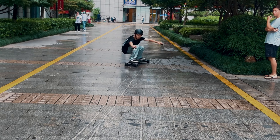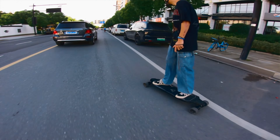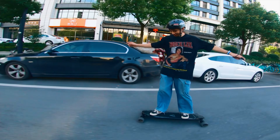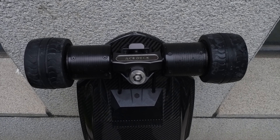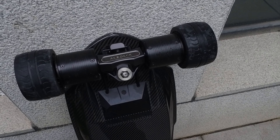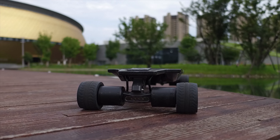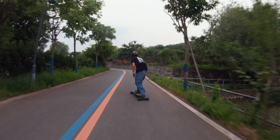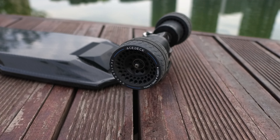Next up are the wheels. Stock, this board comes with 90mm polyurethane wheels. They feel alright, but you can do slides on them pretty easily, and on concrete sidewalks you are going to feel those bumps. We did manage to put on 97mm rubber wheels, and the vibrations from cracks felt a lot more mellowed out without really impacting performance. That's what I'd personally recommend, because with TKP trucks and a carbon fiber deck, you're going to feel everything on the road — so a softer or bigger wheel is going to improve ride quality a lot.